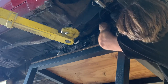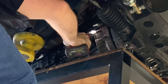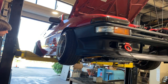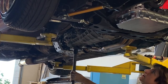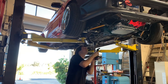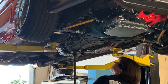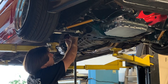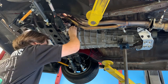After you're sure that the transmission input shaft has gone all the way through the clutch disc and into the pilot bearing, then you can start putting on some of the transmission bell housing bolts just to get them started so that you can raise the car back up and access the rest. Here I like to jack up the back of the transmission just slightly to make sure that the mating surface of the bell housing is parallel with the back of the engine block. I start by slowly going back and forth working these two 17 millimeter or 12 millimeter thread bolts that are opposing each other on the center line of the transmission, doing one side a little bit then the other, making sure the transmission is going on smoothly and not binding until it seats all the way. After I know the bell housing is seated I can go back in and add all of the remaining bell housing bolts.